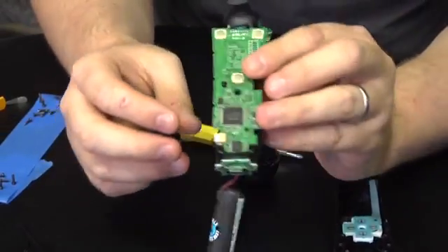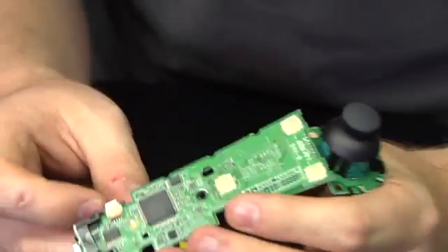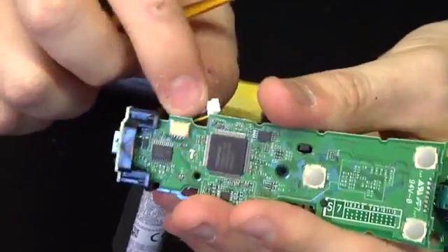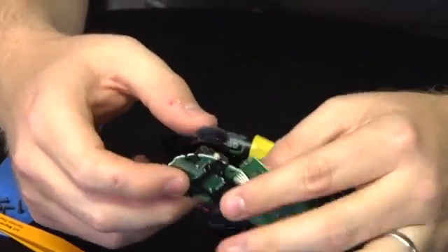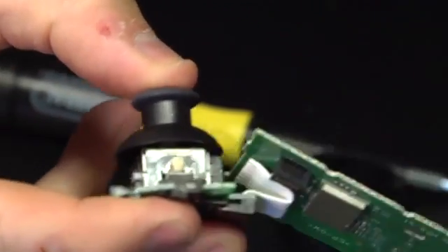Okay so here's what we have: a motherboard on this thing. Looks like another ARM processor. Let me disconnect the battery before I do permanent damage to myself. That was the data connectors and the power connectors. Battery's out — no chance of electrocution. There's going to be some sort of wireless thing underneath this shield probably. And of course the analog stick — you can see how this works. Here and here there are devices that measure the distance moved in two dimensions, and there's a click when you push down on the stick as well. That's the Sony nav controller taken apart.